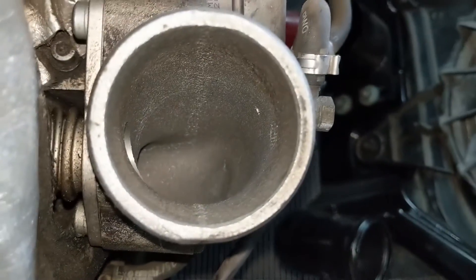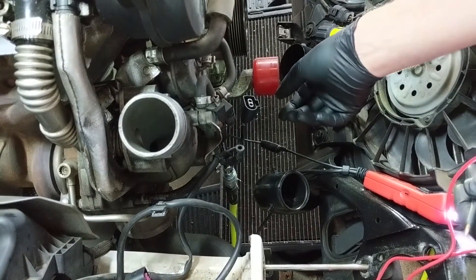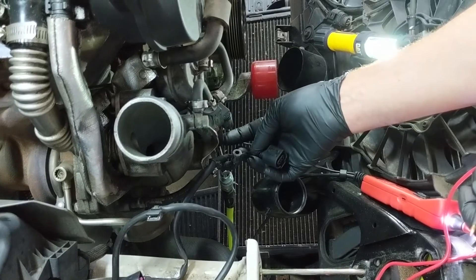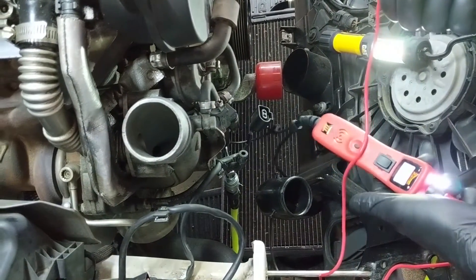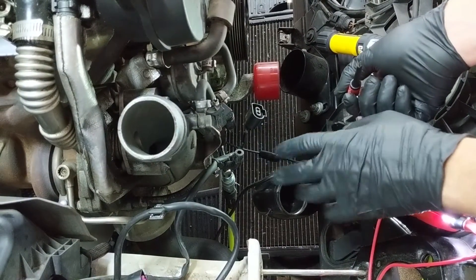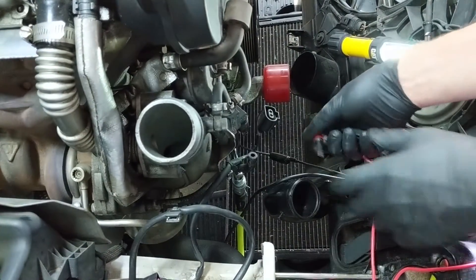All the air is returned, though. To test the active state, what we can do is apply some air pressure from an air compressor down into the stem that takes the boost pressure. Then we apply power to the solenoid — I'm using my Power Probe 3 to do that — and what we should hear is the air going out of the intake tube for the turbo. So here we go.